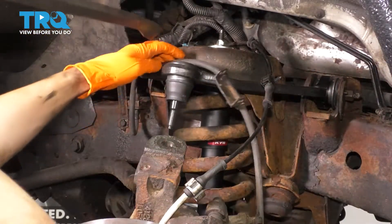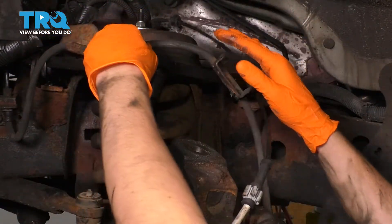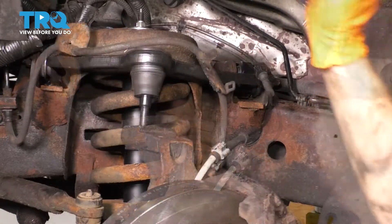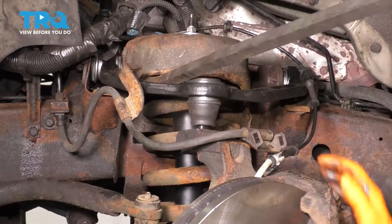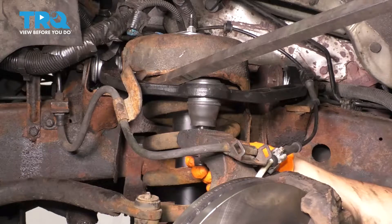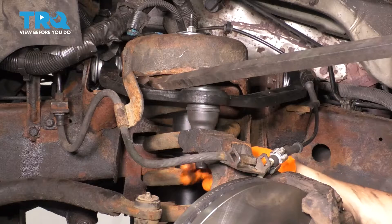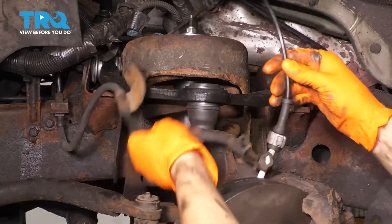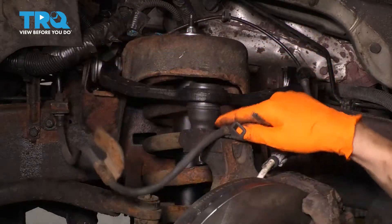At this point we need to bring the control arm down into the knuckle. Make sure your brake hose is up on top of the control arm, same with the ABS wire. Now we'll have to bring the knuckle into position. I'm going to take a pry bar with my mounting nut ready, and as I pry down on this it's going to push the control arm into the knuckle. I'm going to start the mounting nut just a couple threads so it's at least secured. Now we'll check that these are routed properly — which they are — and let's tighten up this nut.